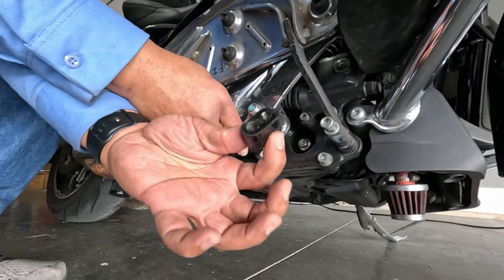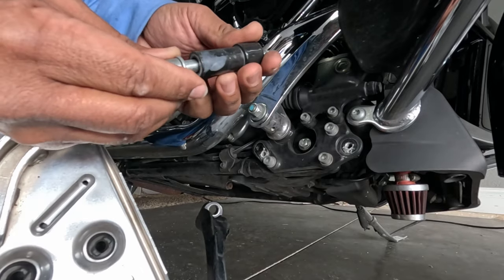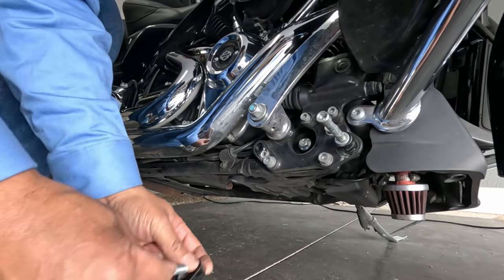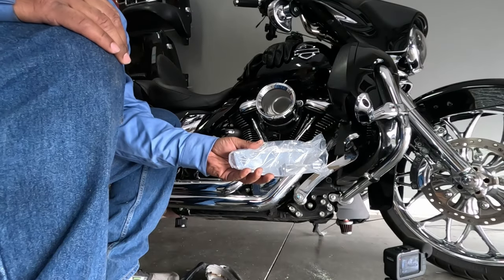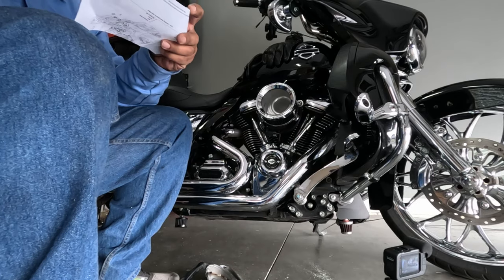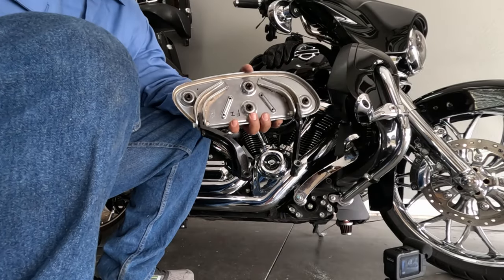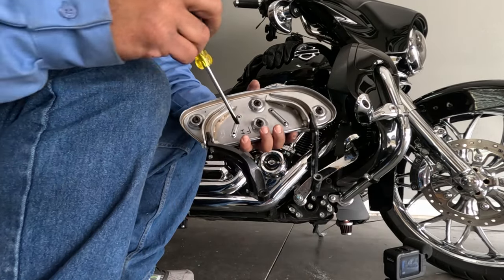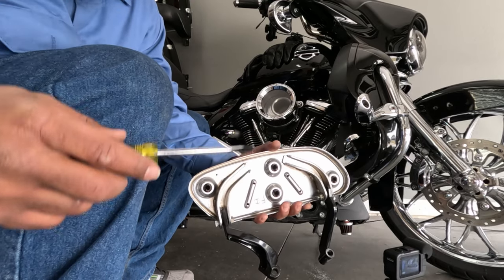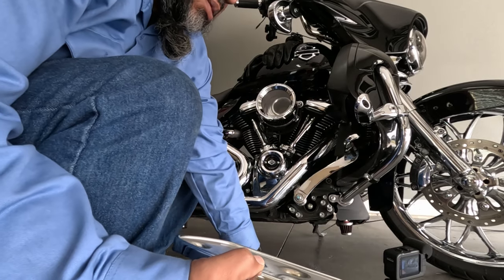There's one — the back spacer. Just so I don't lose them, I'm going to leave it in the plastic just to make sure it doesn't get too dirty. It's got it in the directions and comes with one screw and nut. To remove this floorboard — I actually thought it might have been a screw but what it is, you see these little rubber grommets — press in and slowly work your way in and it pops right out. Actually it was a lot easier than I thought it was going to be.